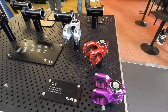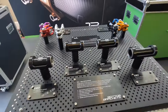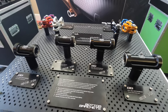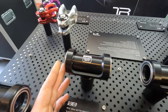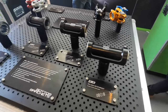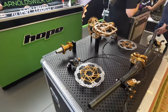Then there are new press fit 30mm bearings. They used to use Enduro bearings, but now they've had custom-made Swiss bearings manufactured, which means they can fully sleeve the bottom bracket. Super high quality bearings, and now a fully sealed system, which is really rare. These are in 30mm size, so they're compatible with Hope's own cranks and also cranks like Race Face.